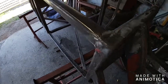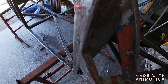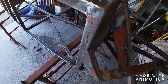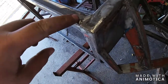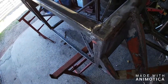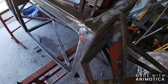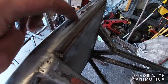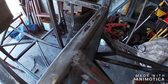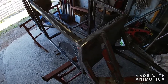That's the rust treatment on. You can see it - there's like a pinky goo - just to help with little areas like right in there where I can't quite clean. It'll turn black as it has done in a few areas, like right there - there's just a little patch of brown and it's turned black now. I'll give it all a wipe down with the cloth and leave it to dry.